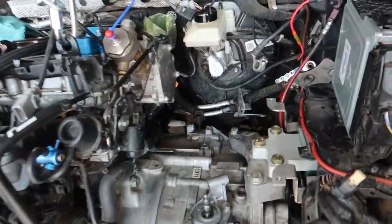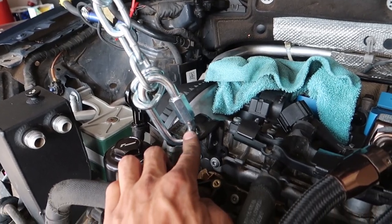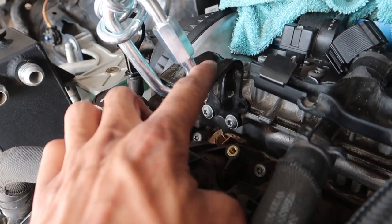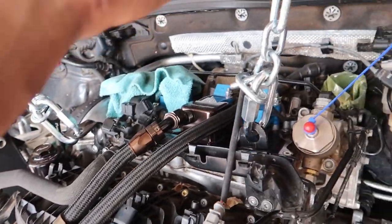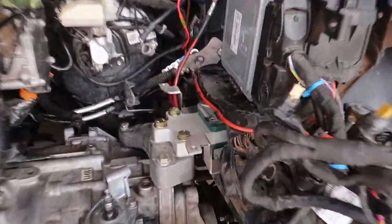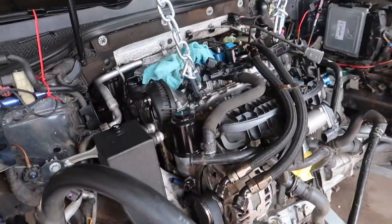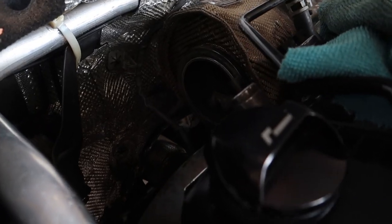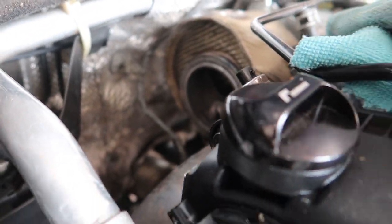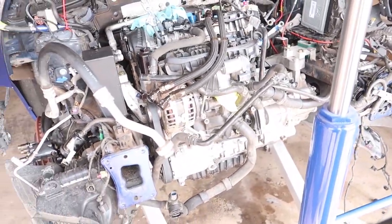All right, we've got all the coolant hoses everything up there undone, and the chains are on finally. There were some plastic pieces over the hook hole — I didn't realize it at first, popped that out and it's the perfect spot. Just wrapped the chains around it. The really only thing holding it in now is the trans mount and the engine mount, downpipe is undone, all that stuff in the back is done. You'll see the pull on the next episode — thanks for watching.